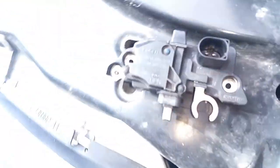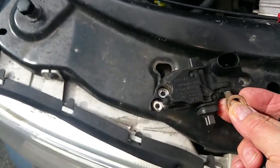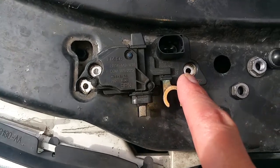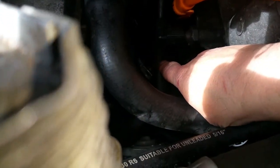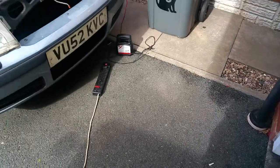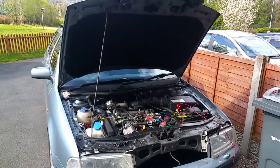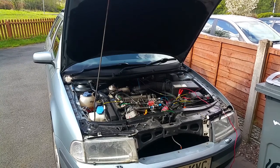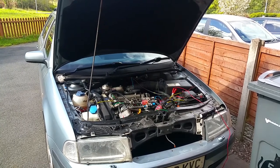Take those off and the cover will come off. Once you take the cover off you'll be able to see the brush pack, and there's literally three Phillips screws — pull upwards and out it comes. It is a bit tight in there; that pipe is in the way. I struggled with the tools — I haven't got a 15 mil spanner, and the 15 mil nut at the back is difficult to get out. I managed to get a 15 millimetre socket on it but couldn't get the ratchet on it.